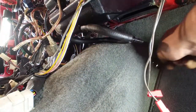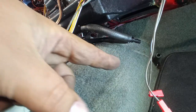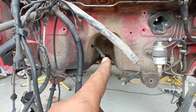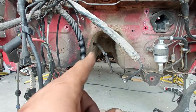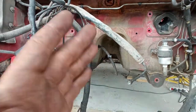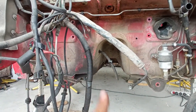Okay, on the other side of the hose, I have a zip tie with an accessory to bite onto the gearbox, so my hose is pointing down to the ground, it's not pointing forward. Because if it was pointing forward on the outside, air can push the water back to the inside, not letting the draining system work with gravity. As you can see over here, this draining pipe has to be pointing down, so I put there that little clip to clip onto the gearbox, and the pipe in that way will be pointing down or a little bit back. If not, then the wind can push in the water again, and maintain the same problem that I had after all the hard work that I did. So I know it was very successful, because like I told you, during 2 years I never had the problem again.